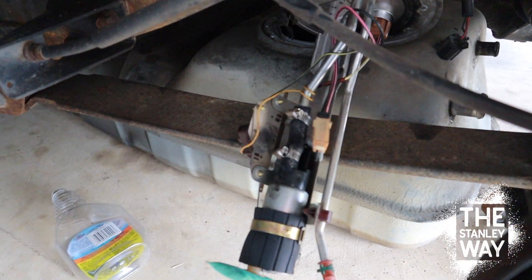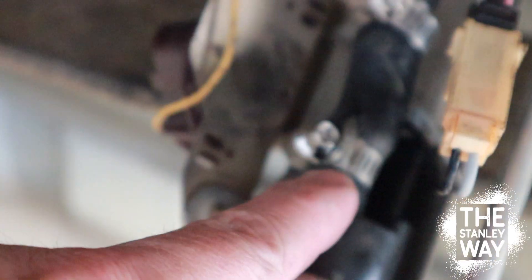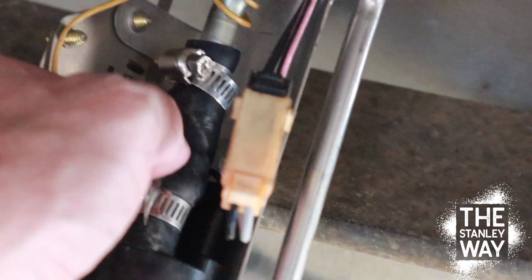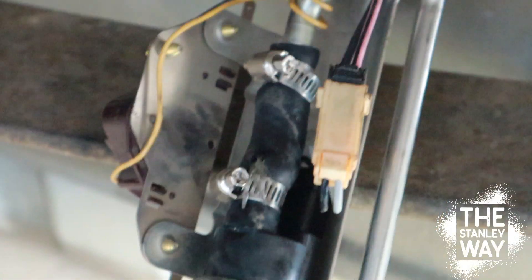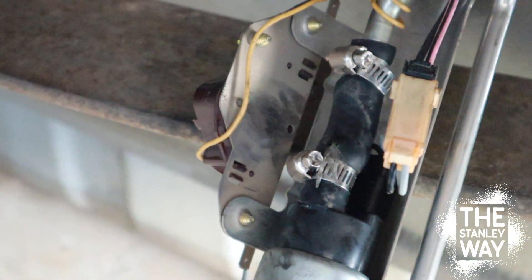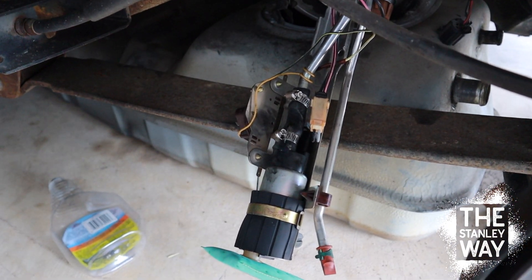I'm kind of glad it happened with us rather than someone else. If you look, the new fuel line that connects the fuel pump up to the fuel line delivering to the engine is busted — you can feel it, it's soft, it's completely lost its rigidity. Obviously that's the bad part. This discount auto parts stuff got me again. I knew I shouldn't have done that and I got so mad at myself.